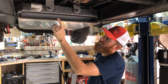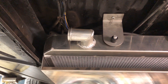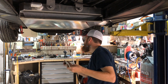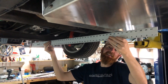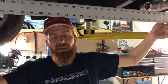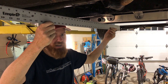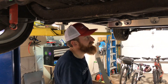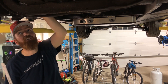This radiator tucks up very nicely. The way they've gone about it, instead of having the inlet and outlet on top causing hose and clearance issues, your number one concern with this install is clearance. If I put this on the frame at the lowest part of the back, that is pretty much level with the frame rail. We drive this bus pretty low — I'll say slammed, though guys in California would think it's a 4x4 — but it rides nice and low and we've never hit anything. The hose comes out underneath and tucks back in and up.